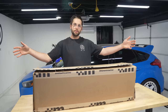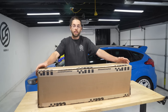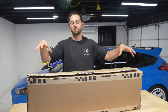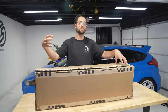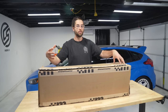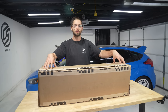This is a good upgrade for this car — it's going to get our charge air temperatures down. Once the turbocharger compresses the air and creates boost, it goes through this front mount intercooler and gets cooled down by the ambient air temperature. Since this is a larger core that flows better, it's going to cool a larger volume of air faster. Therefore the air going into your engine is colder and has more volume, so your car is going to drive a little quicker. It's a great upgrade for any EcoBoost platform.